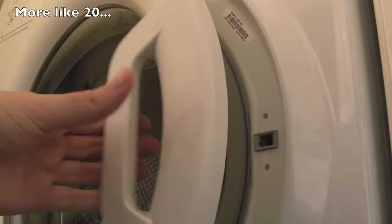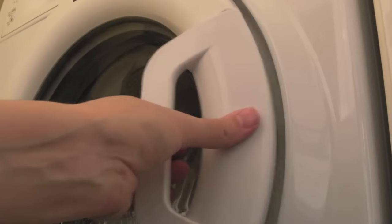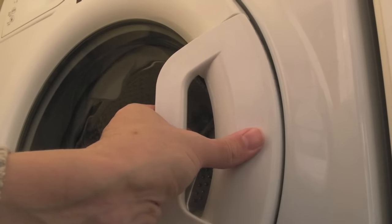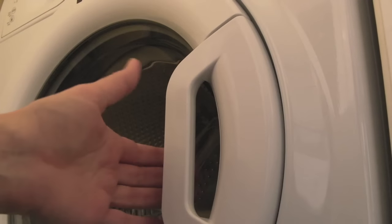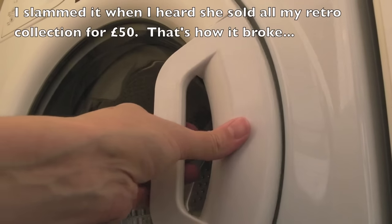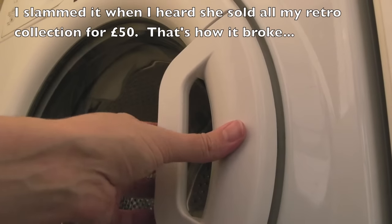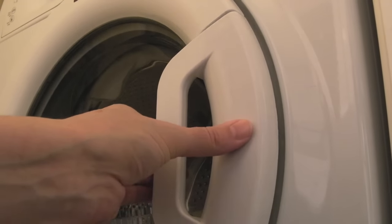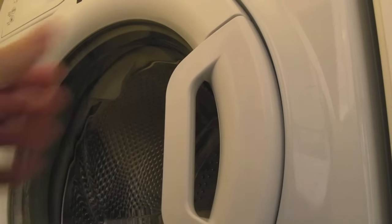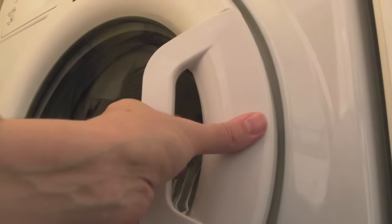Door's shut — open, shut, open. Just be careful with these. It's very fragile, the switch. I'm wondering if assisting it in is the best way going forward. As you shut the door, don't just slam it — push it really slowly and hinge it in. You put it to that point, it won't go in — lift the handle out until the door shuts and then release the handle. The catch is in. That's probably the way to extend its life.